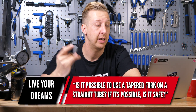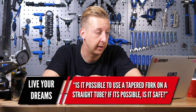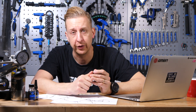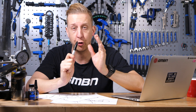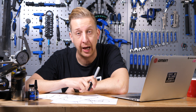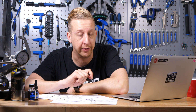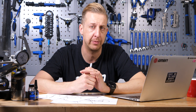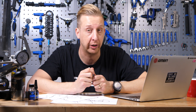Next up is from Live Your Dreams: is it possible to use a tapered fork on a straight head tube frame? If it's possible, is it safe? Well, it totally depends on the head tube size on your particular bike. You can use a tapered fork in a straight head tube — if you've got a 44mm head tube you can do that. But it completely depends on your frame and what headset options are available. I'll throw a link in the description to the Cane Creek Headset Finder — it's a really useful tool where you can input your frame and fork and it will find a compatible headset combination. However, if your head tube is inch-and-an-eighth and your steerer tube is inch-and-an-eighth straight, you won't find a way to fit a tapered one. Also, never try to use external headset cups on an internal-style frame — pressing those in can crack or damage the frame.